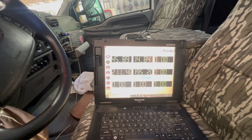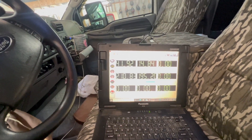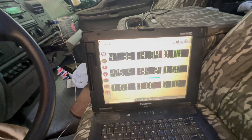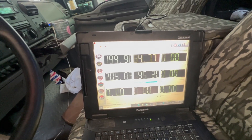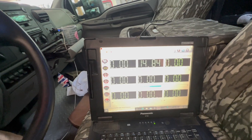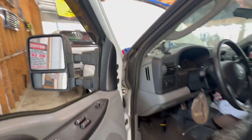I also wonder if his fan is doing the right thing, because I had a fan circuit code on here as well, but we'll check that after we get this crank no start hot addressed. Let's see what we make on ICP trying a crank — 200 is what she'll make.